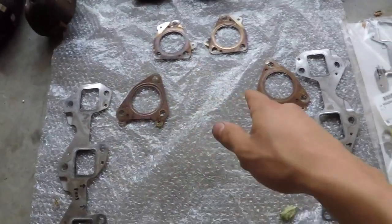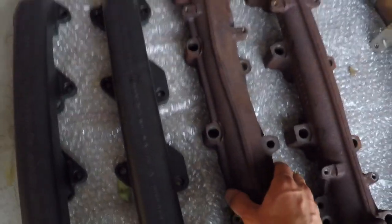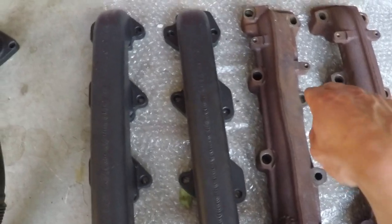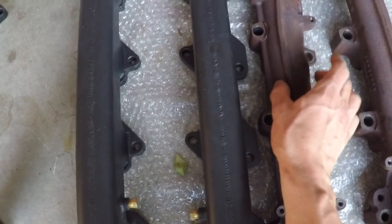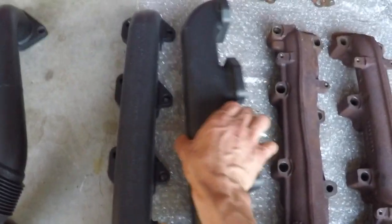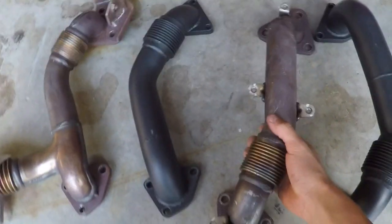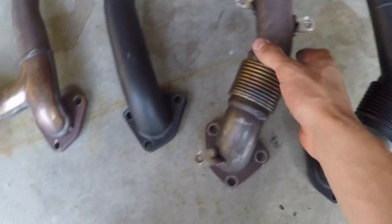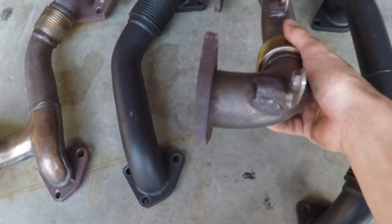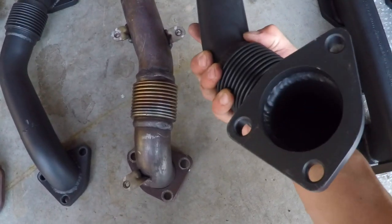I'm going to show you the parts I've taken off so far and the parts coming on. We have new up pipe gaskets and new gaskets for the new manifolds we're putting on. The big one that restricts you is the driver's side because your steering shaft goes right through here — that's where these HSP ones shine. As you can see, there's no restriction from the width, and looking from the side view it's a heck of a lot better. On the up pipes, this is your driver's side one — no EGR in this one — and it has a better diameter. The key to these is the elbows right here — they're much smoother bends, which allows for a lot more flow.